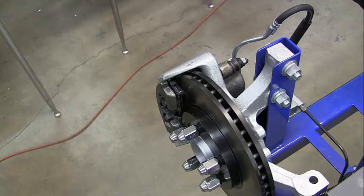At the end of the lab, make sure you torque the wheels on properly. Then you have about four questions to answer: list a few of the different spots you checked for leaks; give me the thickness of the front pads and the rear shoes; note what type of brake fluid the vehicle takes — you'll usually find that on top of the reservoir cap, whether it's DOT 2, DOT 3, or DOT 4; and finally, list any recommendations for repairs you found. Once you have that done, bring your lab packet to me and we'll get you signed off.